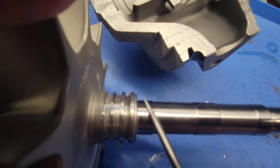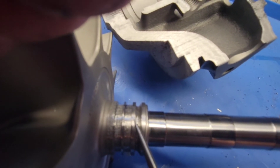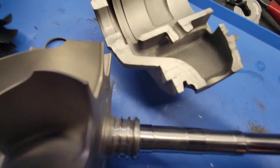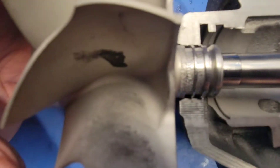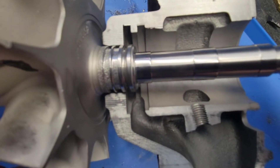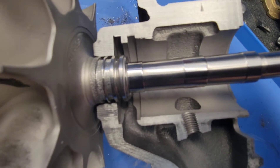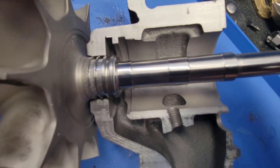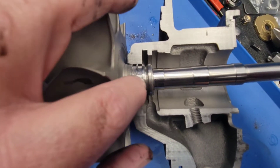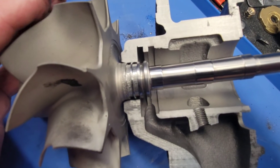This particular Garrett shaft has a rear exhaust seal, front exhaust seal, and then you're going to see this little feature right here — that is an oil flinger. So when the turbo is spinning, your two seals are in the seal bore, but this oil flinger — you see it's in that oil cavity. So the turbo is sitting there running, it is flinging excess oil away from your exhaust seal. Remember, your exhaust seal is not designed to run in oil. It's designed to keep the exhaust gas from getting back into the bearing cartridge and creating exhaust dilution into the bearing structure.